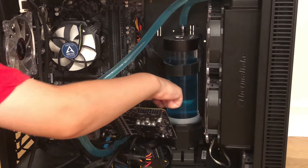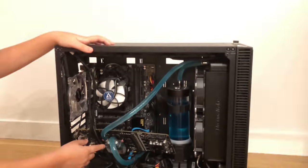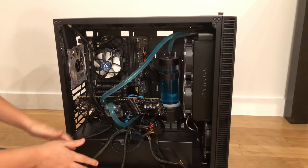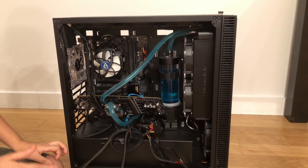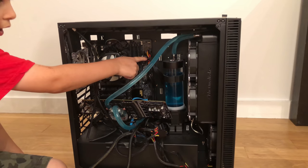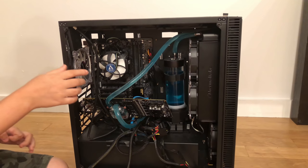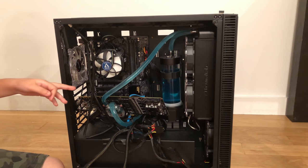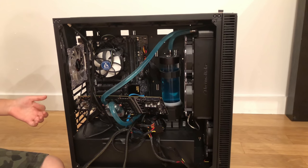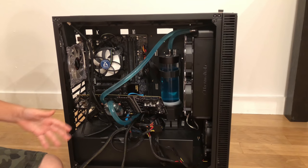It's just one tube going to the GPU block and so on. So what we're going to do is take out these two pipes, have a bucket, and let the water drain out. If some water is stuck, we'll take it out and use a little adapter that only runs the pumps and fans to push all the water into the bucket. That way we'll drain the loop so we can do maintenance and maybe replace the GPU.